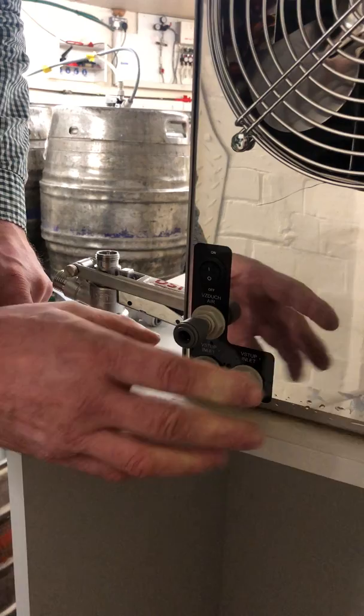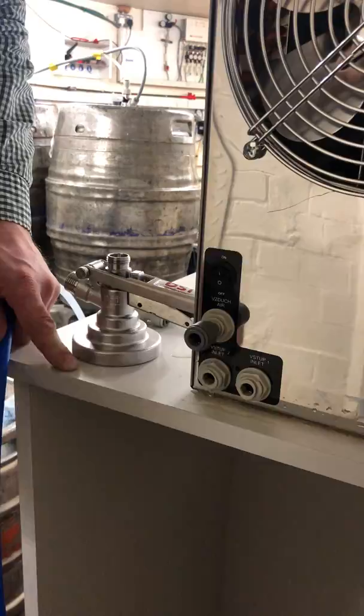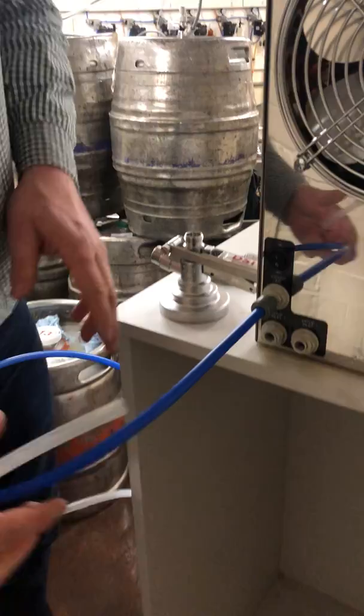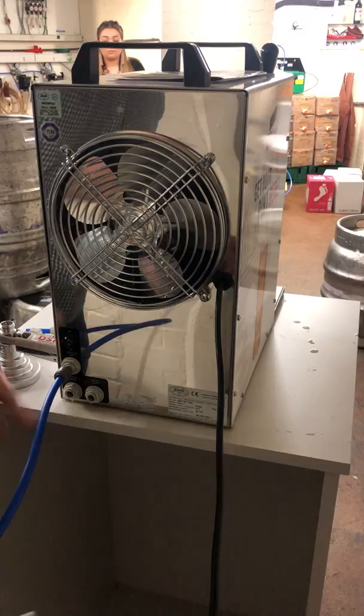You won't be able to get that wrong because the product lines are of a larger 3/8th of an inch. So that pushes in gently. Then we'll take the blue pipe and push that in — that sits in with a nice positive feel as it clicks in. On this occasion, we will use the left-hand tap as we look at it from the rear of the machine, so this would be the left-hand fitting. Accordingly, if we were using the right-hand tap, we would use the right-hand fitting.